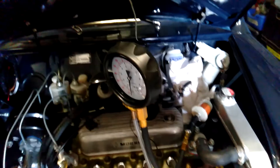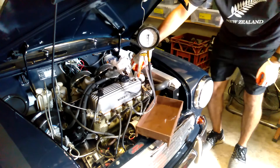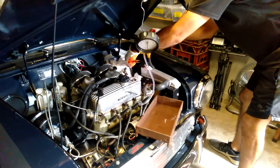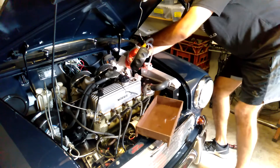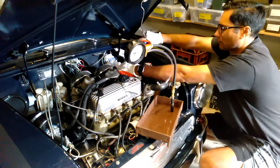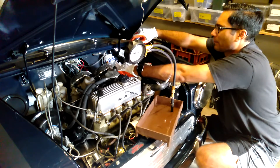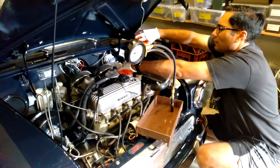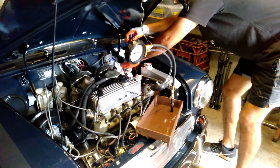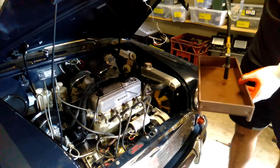Let me just clean this up because it's making a mess everywhere. I'll put my gloves back on. The first thing I need to do is just disconnect that hose off the actual fuel filter. The pressure has been released so fuel will drip out, but I'm not going to get an excessive quantity. Just make sure the ignition's off so you're not getting fuel pumping out. I'm going to let the fuel evaporate on this hose, and once that's evaporated I'll turn the ignition on again just to make sure I don't have any leaks. It would be good practice to tighten everything up as well. I'll take this tray of fuel outside so it can evaporate.